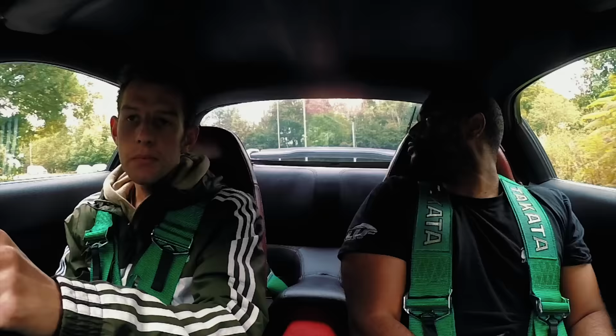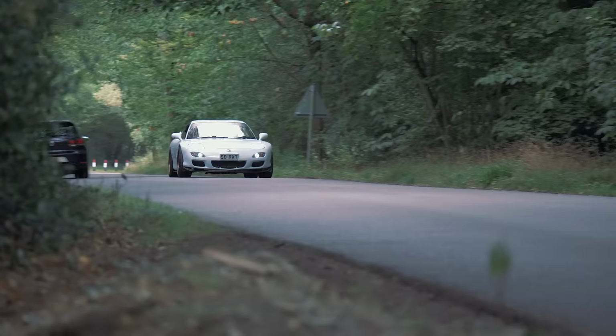Underneath the bonnet, there's two things going round. There's no pistons, there's nothing generic about its engine. You can barely see the engine. It's totally new, there's a load of craziness going on. It's tiny, literally tiny. The bad thing about it is that you've got to service it a lot because if you don't maintain it, the apex seals will just wear out, and then that's basically your compression gone. Once your compression's gone, that's it. You might as well do a rebuild.